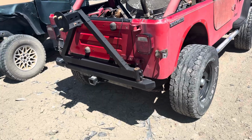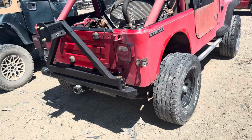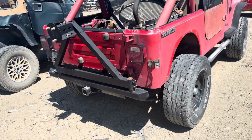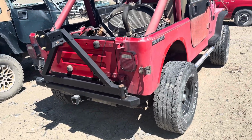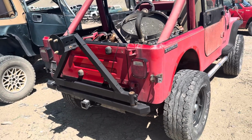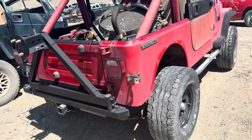But usually, for those of you who don't know bed liner products, they're not really made to come off unless they were applied poorly. So if you have this inside, you might think, oh, I'll just peel all that stuff off, or I'll sandblast it off. A lot of times you'll end up sandblasting through a tub before you get most of it off. It wasn't made to come off. Unless you did it by hand, you'd end up blowing through probably the tub. There are products out there that neutralize it and thin it out, but we just don't mess with any of that stuff.